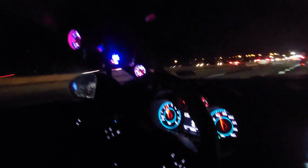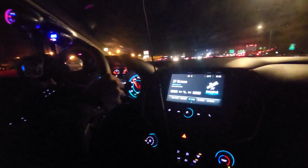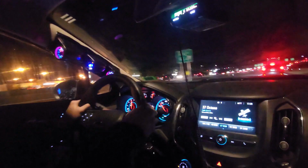Nice. Give it a little, well, I guess we can't because traffic. Nice. I just wanted to get the boost gauge. It sounds nice. Also, while I was not recording, we noticed the howl is quieter because it's venting half and recirculating half, which is how you prevent it going super rich.